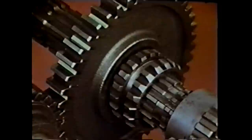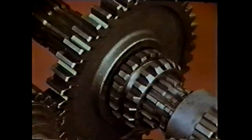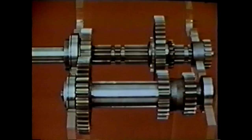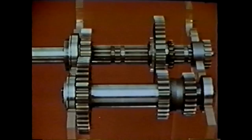The main shaft gear has a second set of teeth facing inward, which mesh with a component called a sliding clutch added onto the main shaft. The sliding clutch has teeth on both its inside and outside diameters. The inside diameter teeth constantly engage the spline on the main shaft so the sliding clutch always rotates with the shaft. To shift into first gear, the sliding clutch is slid along the main shaft until its outer teeth engage the inner teeth of the main shaft first gear, locking the gear to the shaft. Now the gear train is complete: power from the engine drives the input shaft, the counter shaft low gear drives the main shaft low gear, and the sliding clutch locks this low gear to the main shaft so the main shaft turns in the same direction as the input shaft.